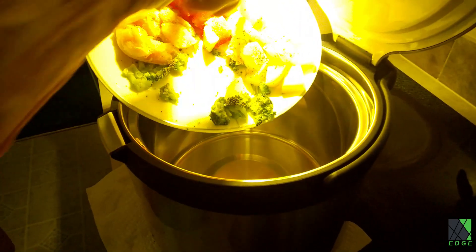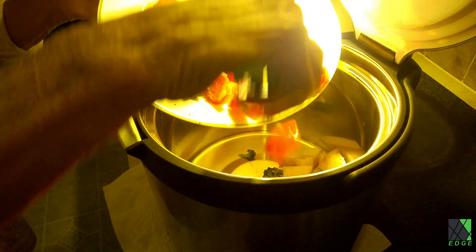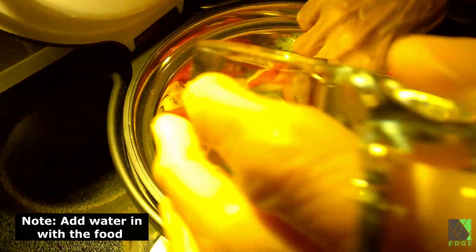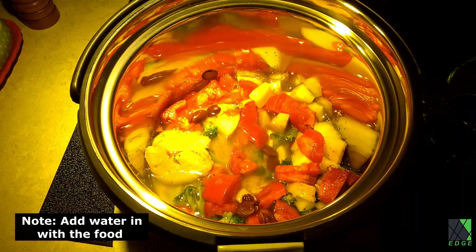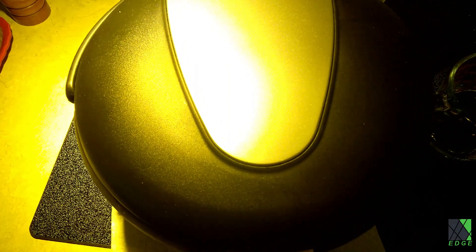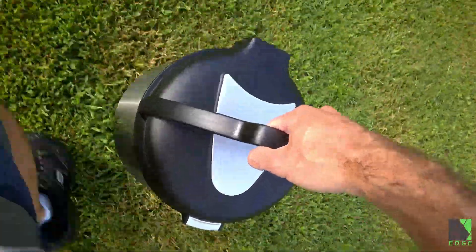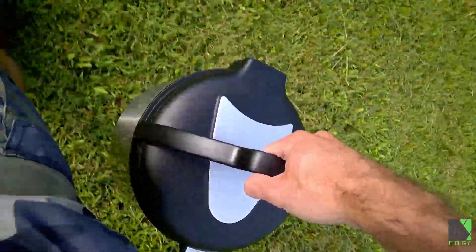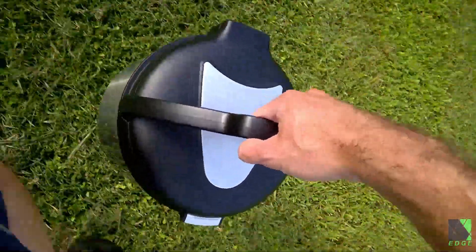This is some of the easiest DIY solar electric cooking a person can do. You literally just plug in the solar panel and let it heat up and cook. Effectively, this appliance has become a very efficient DC instapot or slow cooker. I tested a 50 watt solar panel on this cooker and it got pretty hot, but I needed a 100 watt solar panel to get decent results. On the other hand, the 100 watt solar panel does have the potential to burn out the appliance, so I have to be careful.